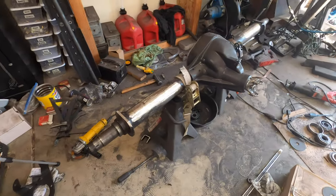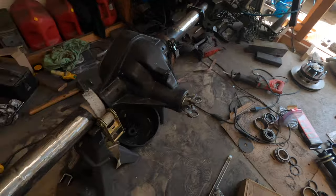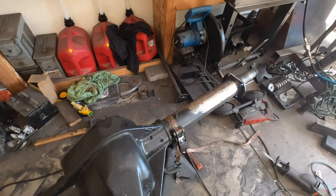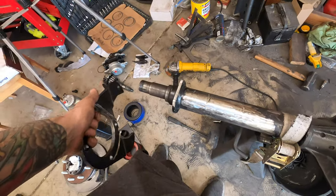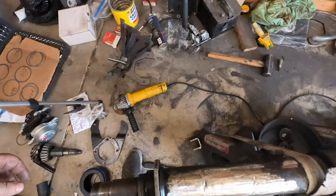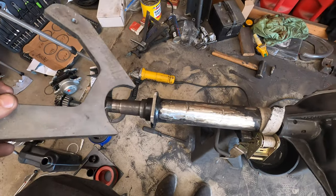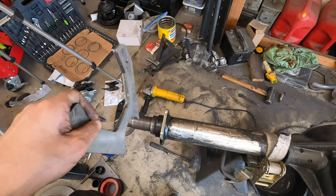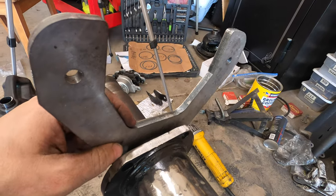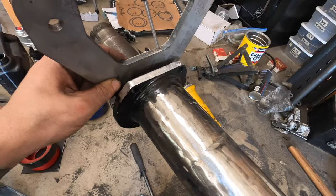You can see how much grinding it was to get everything off just by all the shavings on the floor. We can't even bring the Samurai into the garage until I get this all done — what a mess. It was really tough to get all this stuff off and I got a couple gouges I'm going to fill in. The brake caliper brackets are cut off — these weren't designed to fit onto this axle, but I thought it was close enough to just weld it up to this raised ring, but it isn't. Pads are really close on one side, so we're going to use the other caliper bracket that came with them. I'm going to assemble everything, torque it down the right way, grab the bracket, bolt it to the caliper, see where it lines up, and that's where we're going to weld it so it's right in line with where the brakes need to go.